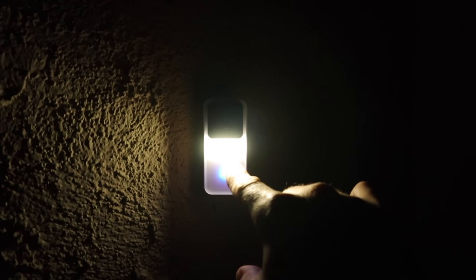Down on the doorbell itself, it has a really nice bright LED light that does a great job of lighting things up and lets anybody know they're on camera — I do kind of like that feature. I'm going to wait for that light to turn off. And now you see those little LEDs pop on — those are infrared LEDs that basically give it night vision. You can see them on the camera because the camera picks up the infrared, but you do not see that in person. All you'll see in person when you walk up is that little blue doorbell symbol. At the start of this clip we have night vision on with the IR, then the light turns on and it goes to color. The image is pretty good, a little bit washed out up close, but it's still not bad considering it's only using that light and no porch light.